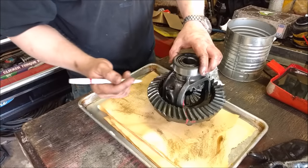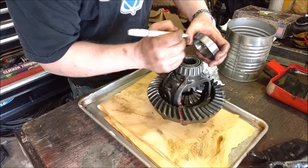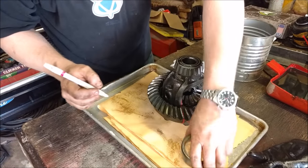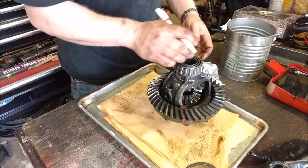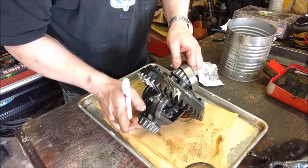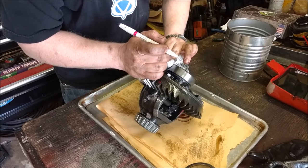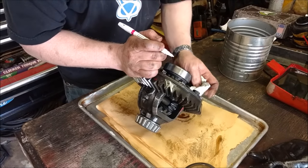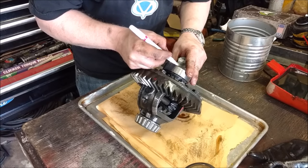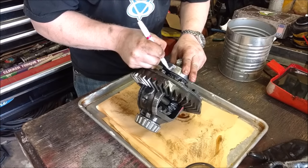We want to make sure we don't switch our bearing caps, so I'm going to use my paint pen to mark which is the driver's side, just so I don't get mixed up — because they're bedded into each other and I'm not replacing the bearings. I like these Sharpie brand paint pens; I picked them up and they're cheaper than some I've used in the past and work phenomenally. I'll put a link below. That one's passenger side and they still look good.